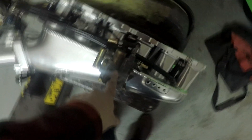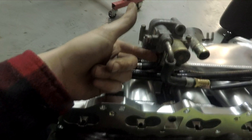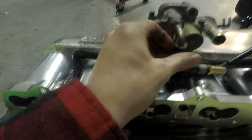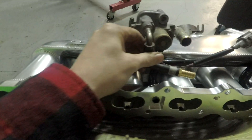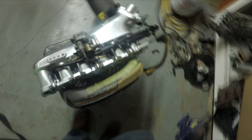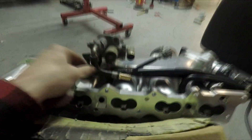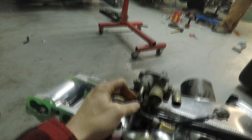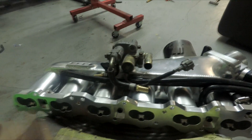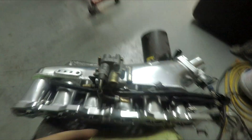So what we're doing today is getting water lines to my idle air control valve. I kind of have a few things set up here already. I just wanted to make some 90s coming off of these two ports. This is the inlet - it's a little bit bigger line. So it's just a 90 with - I believe this is quarter inch line. I should have measured. This is quarter inch line coming out of here and then into a 90, which this tube here is like a three-eighths inch line, so it's a little loose, but it's more for mock-ups. We got a quarter inch adapter to a half inch adapter.